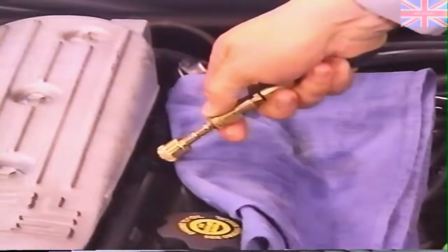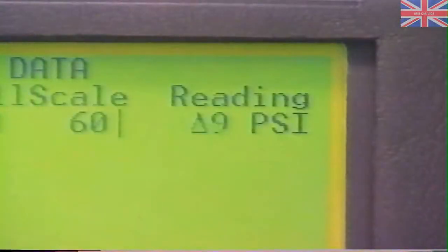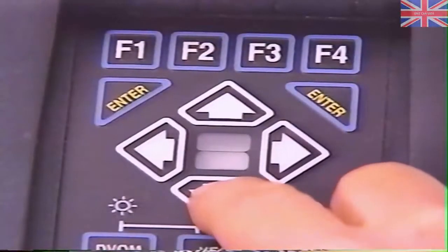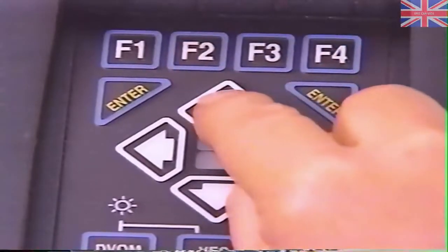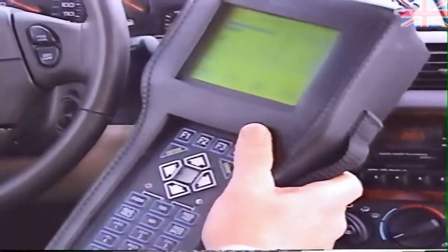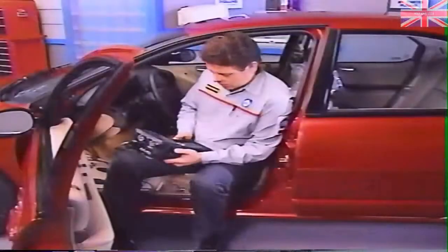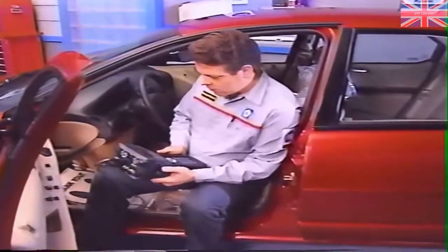There are four live data modes. The normal mode shows a bar graph and the current pressure reading. The min-max mode shows the minimum and maximum pressure values as well as the current reading. The delta mode shows a bar graph of the reading plus the difference between the original and current pressure value. You can change the input mode by selecting the input with the arrow key, then pushing the appropriate F key. If you're checking pressure during a road test, it's best to record the information and play it back when you return. Press F4 at the live data display to begin recording, and press F4 again to stop. There is a recording capacity of at least 30 minutes as long as no other event is stored. When you return, you'll be able to review the recorded event on the DRB-3 just as it happened.